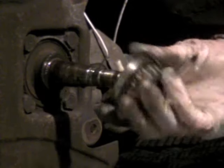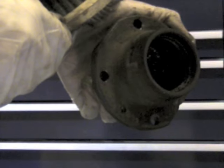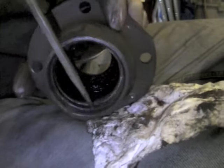It's actually never this easy. You're going to have to hammer and pry to get that inner bearing and grease seal off, then clean up the spindle from all the grease and grime. Use a wire brush to clean up the hub assembly so it's nice enough to start working on the inner bearing races.